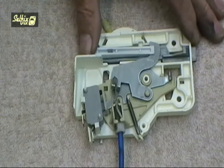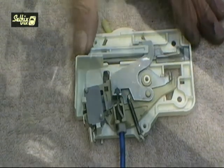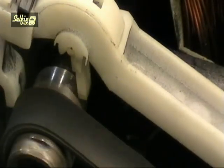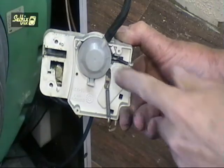And this is how the door is prevented from opening when the motor is revolving. As you can see, when the motor is running, the pecker is thrown off the pulley shaft and the inner cable is slack, which prevents the door from opening.